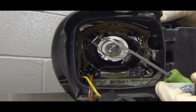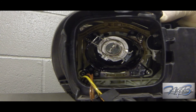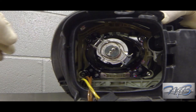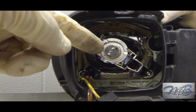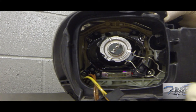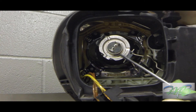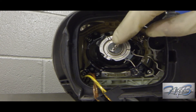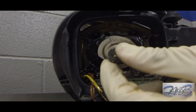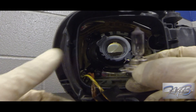Like I mentioned, on the top left there are two hooks. To remove the cage bracket, you're gonna have to press in and then downwards. Once you've done that, it will swing out of the way. Now the bulb is loose and ready to come out. Notice the bulb cannot turn because there is a little notch in the bulb design, and the headlamp has two little tabs that hold it in place.